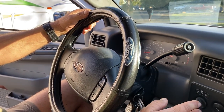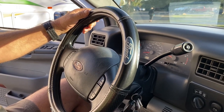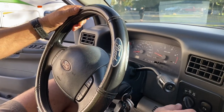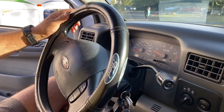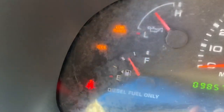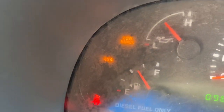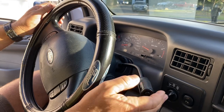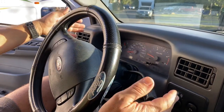What my wife barely remembered from when we bought the truck — and the salesman was actually test driving it for us — is that to engage your 4x4, what you have to do is put the truck in neutral first. Then you change the selector switch to the mode you want. You'll see there in the dash display 4x4 and low or high are selected.